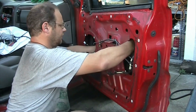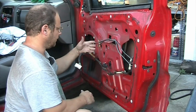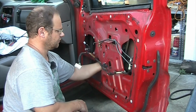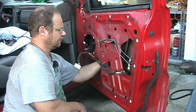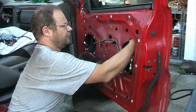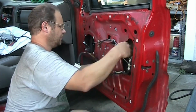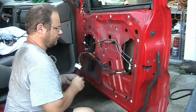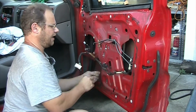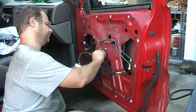Once you rotated it, don't worry about the bolts yet. Keep your hand either in the opening where the speaker goes or down here below, and get the motor lined up into its openings. That's the most important one. So also look where everything else goes, but as soon as you have your motor in, go ahead, hold it in the back, and hand apply already the nuts to it.